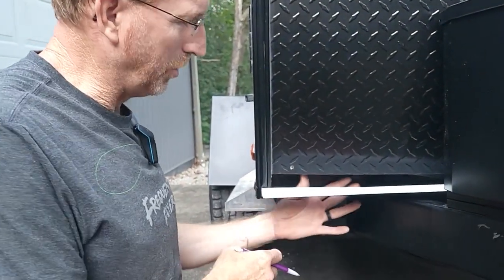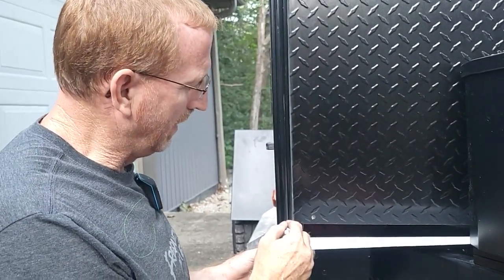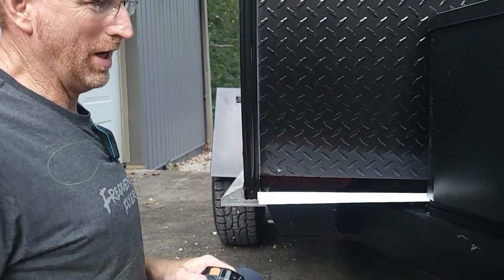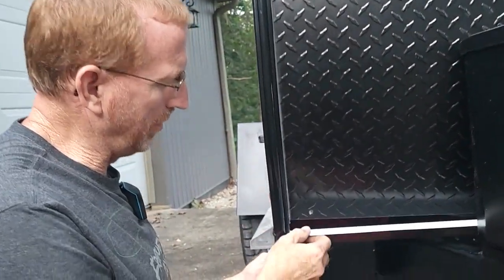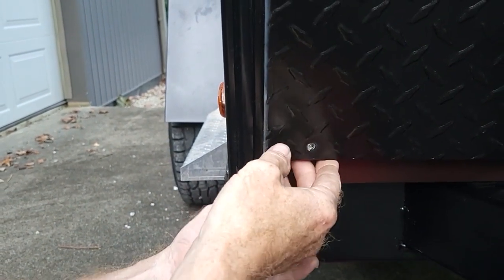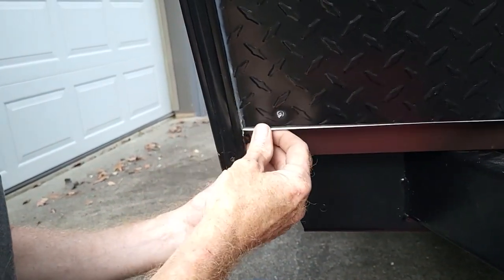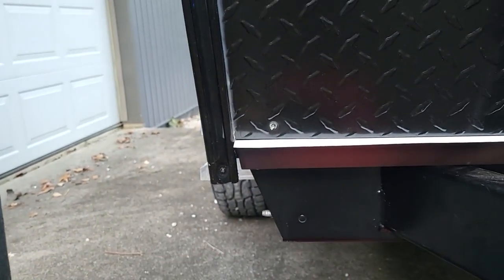The main thing is to get as much protection on this house wrap as we can. We'll slide this over from that side — we'll be behind the trim on both sides, we just won't be all the way to the edge, but that will be so much better than what it is now. I made the cut and shortened it up to about 59 inches, but each one is probably going to be a little different so I wouldn't go with my measurements — I'd measure each one individually. I've shortened it now to where we're right at the edge of this trim, and I'm able to get this to go in there now.